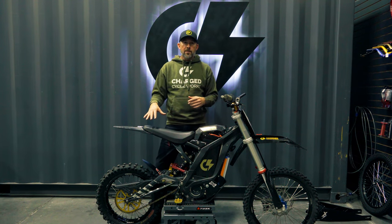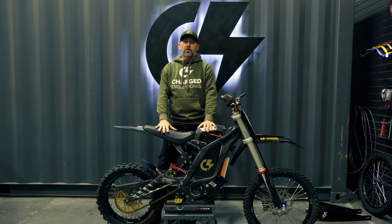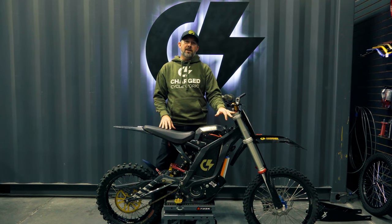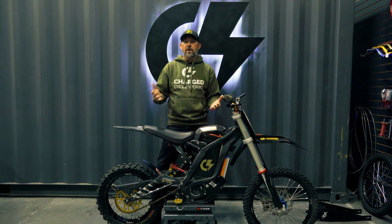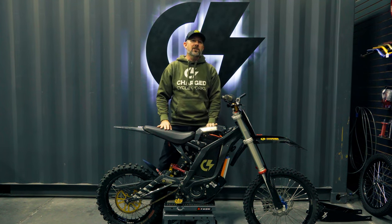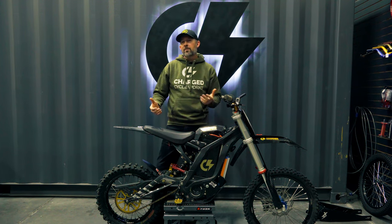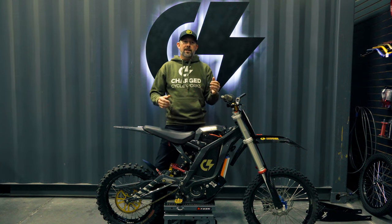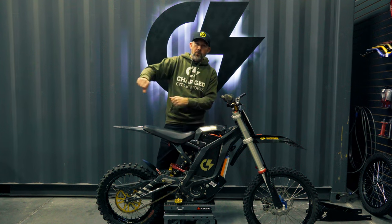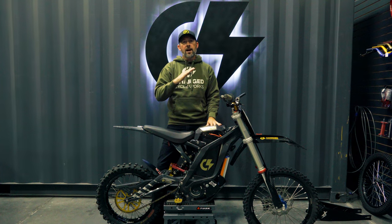I still have the stock swing arm. One of the problems I had — the very first ride on this bike did not go very well. The front forks on these KTMs are three inches longer than your mountain bike forks, so that raised my front end up by three whole inches. That causes a lot of problems: the bike wanders all over the trail, it doesn't want to turn, the front end washes out. Those are some of the symptoms when you raise your front end too high.